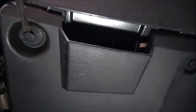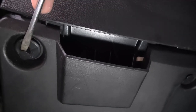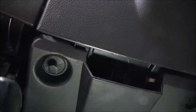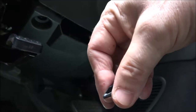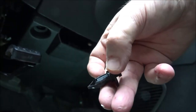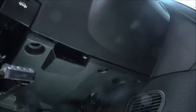Now if these things break, don't think you did something wrong because they will — not all the time, but most of the time they'll break. They get old and brittle. You can still buy plugs like this at the parts stores or order them online. These tabs on the side give in and go up in the hole, and when you push it up in it spreads them out — that's what keeps them in. There's a lot of these on a lot of cars nowadays.